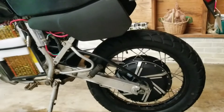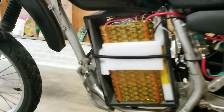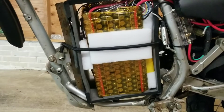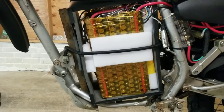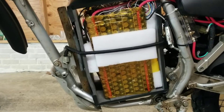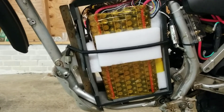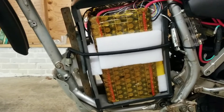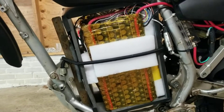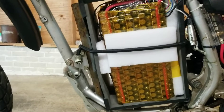The battery was a homemade creation. I used Tesla Panasonic batteries — I had to rip them out of a Tesla Model S module. All together it's 20 in series and 16 in parallel, for 3.2 kilowatt-hours of battery capacity. It's capable of 160 amps peak output at a nominal voltage of 74 volts, which varies between 60 volts and 84 volts depending on capacity — 84 volts is full, 60 volts is empty.